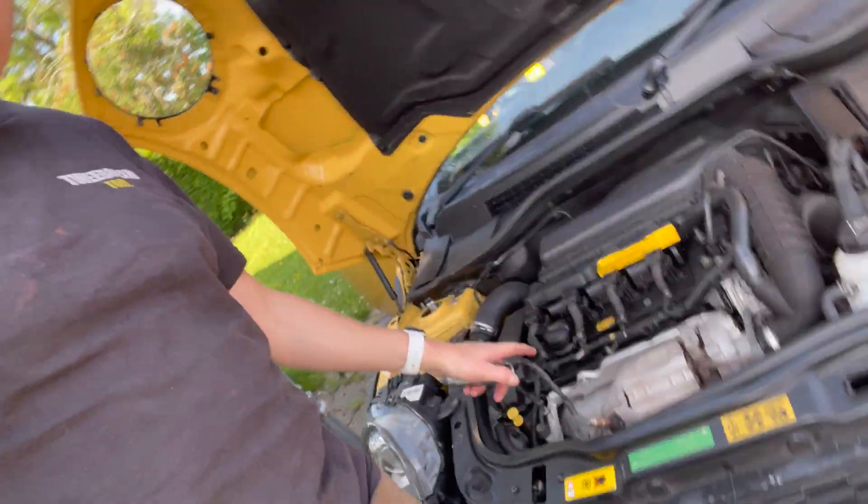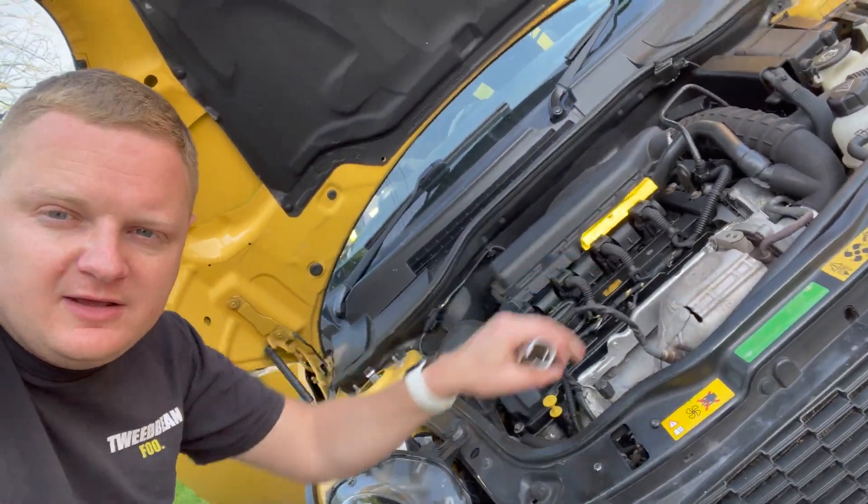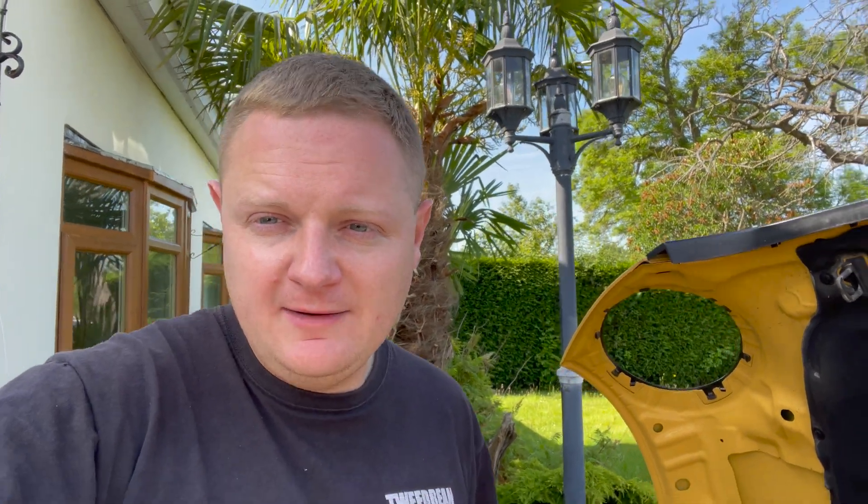As I knew it was a problem, I've actually already got this top O2 sensor on the shelf ready to fit. I'm going to talk you through how to change that sensor — it's really easy to get to. You can see there's lots of access there. Someone's actually already taken it out before because it came loose immediately. It's a 22mm socket with a cut-out for the wire — a special one you'd need to buy on Amazon or eBay rather than a standard Halfords set.